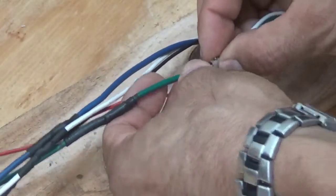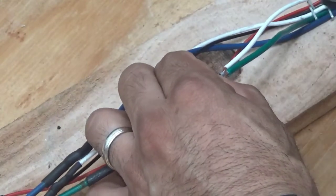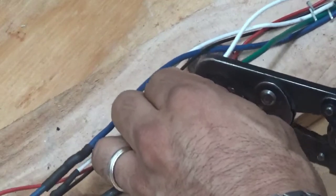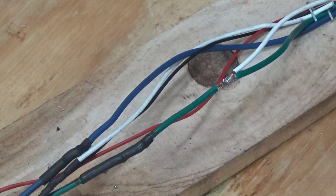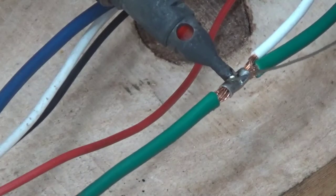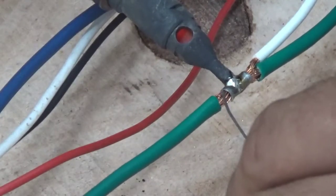So now I can attach the wire on here without cutting the main wire. This is where the splice clip comes in handy. So you attach the splice clip, and you grab your soldering iron and heat up the clip directly. You can actually feed solder into that hole. Feed solder into the edges.